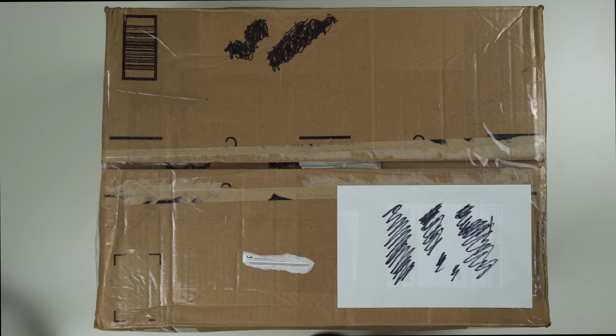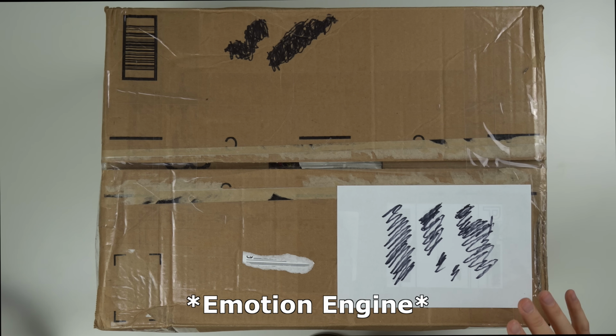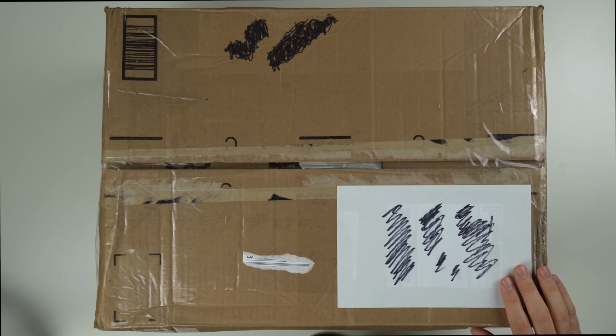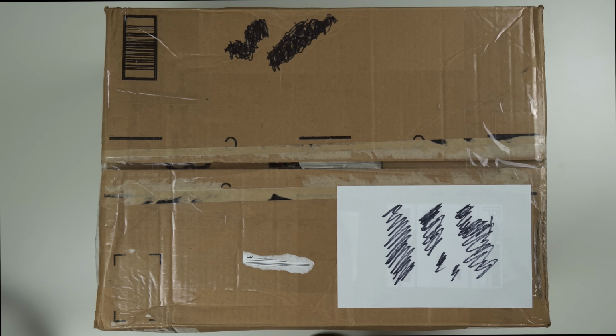If you're not familiar, on the original PS3, the CECH-B01, it uses the emotion chip, so I can basically play every game from the PS2. This and the 60GB version, the CECH-A01, are the best consoles for playing PS2 games on your PS3. The 80GB version works, but it's only compatible with, like, I don't know, 75% of the games or something.